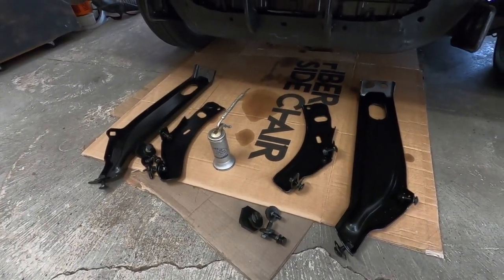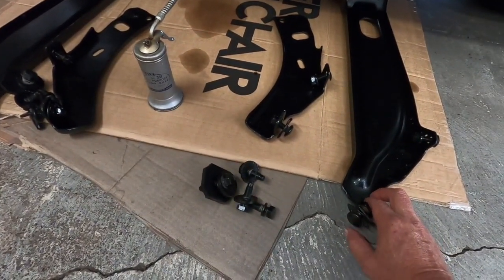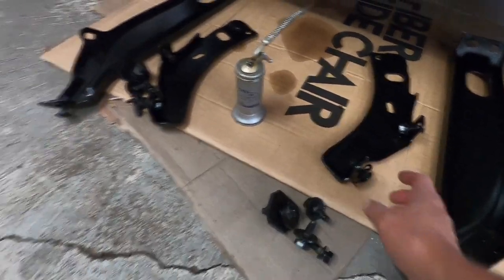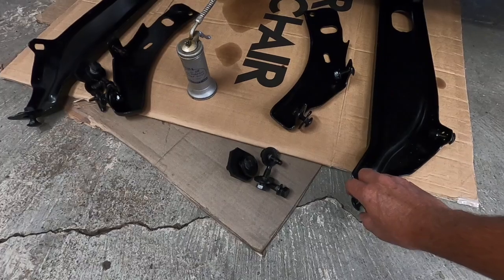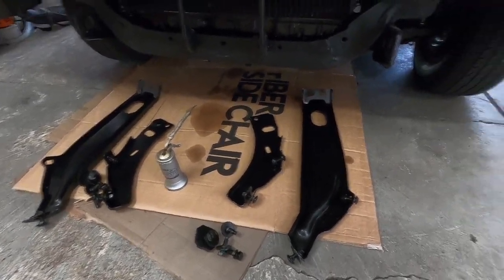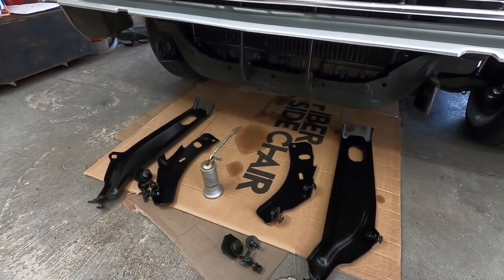And now I'm going to start attaching to the brackets of the chassis, and then I'm going to put the bumper up. And these are the original bolts, and I just painted them because I wasn't reusing them, but I wanted to keep these in place where they were because this is the original bumper, and these shims will probably still be needed exactly where they were. And when I put the rear bumper on, the replacement rear bumper, the original's in that box, and all the same shims, same spots to get it to line up good.